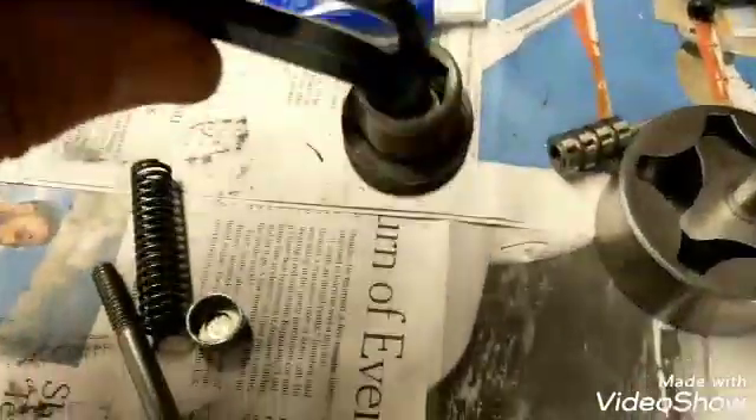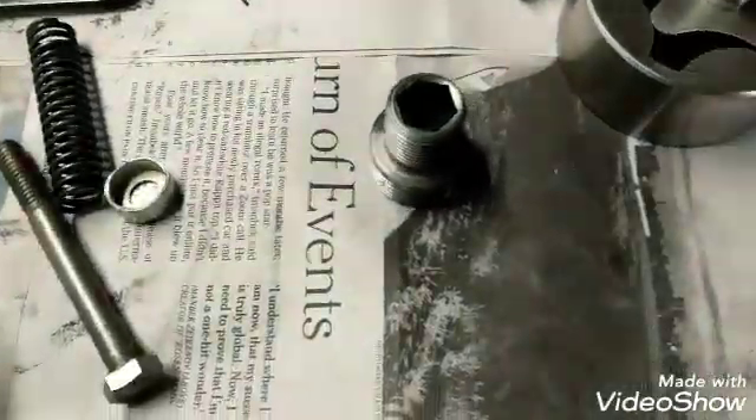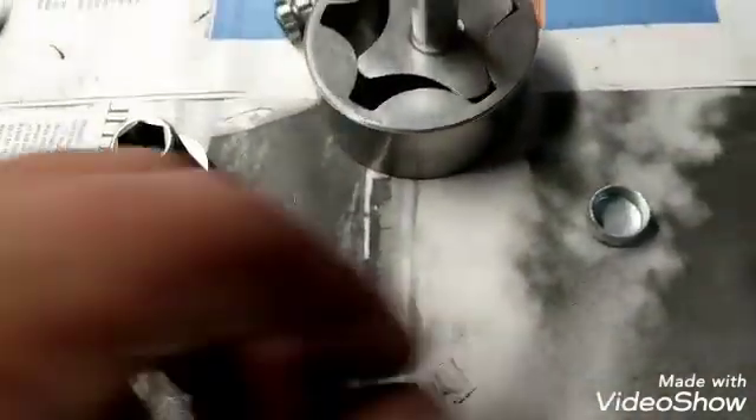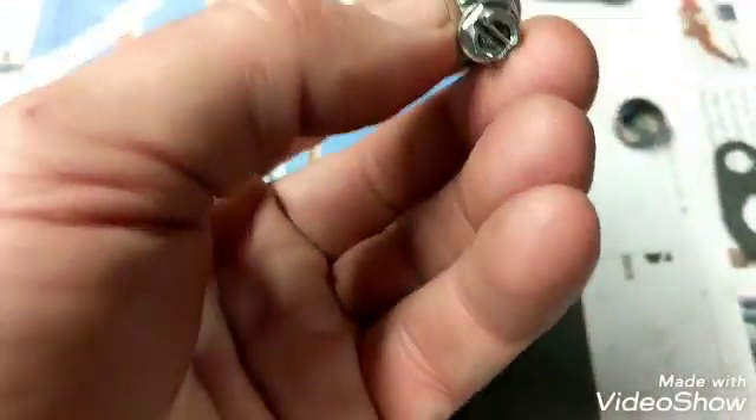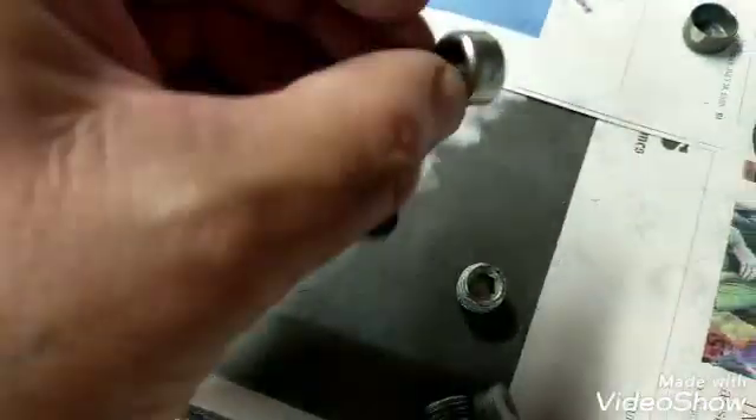If I can do this with one hand — I just finished off the coffee so I'm a little twitchy yet, but anyway, that'll work too. Like I said, it doesn't need to be mongo tight, just get her good and snug. And then to take it apart, I just drill a hole in that little cap right there. These are different than a freeze plug — they're called reverse taper, so when they go in this way they kind of expand to fit.